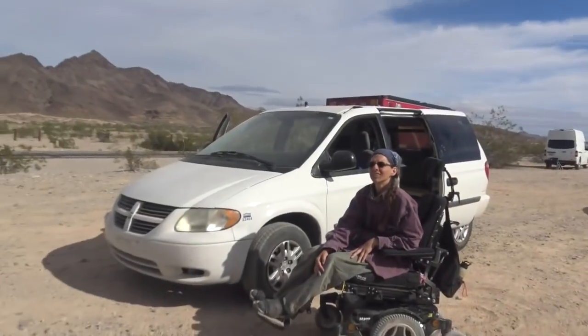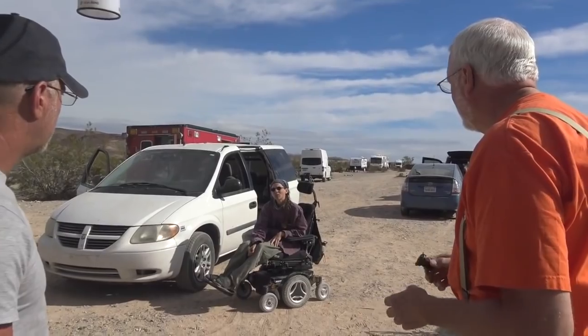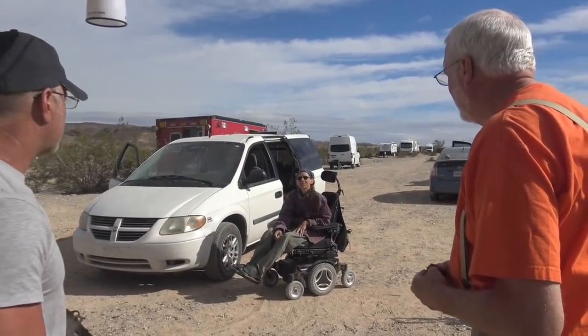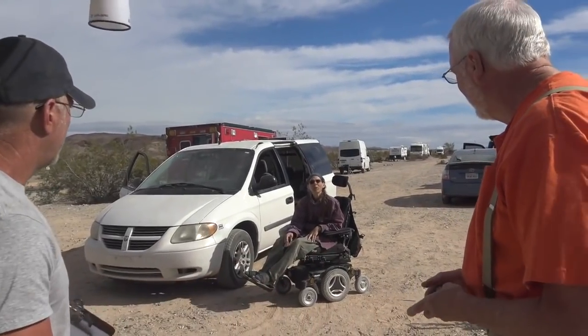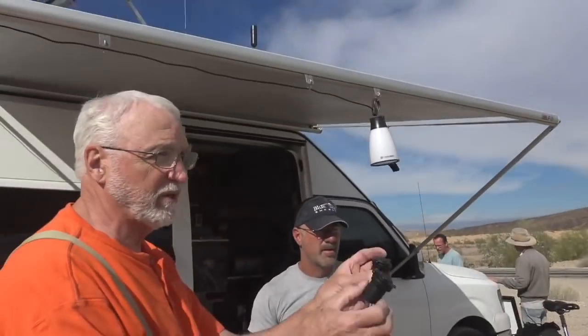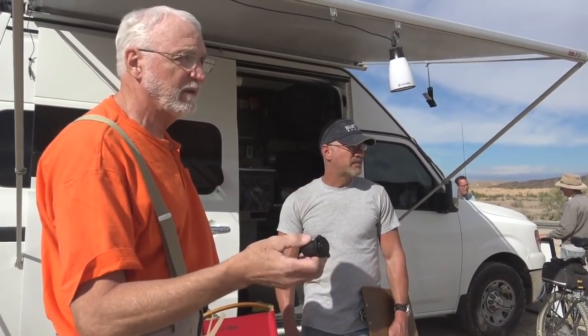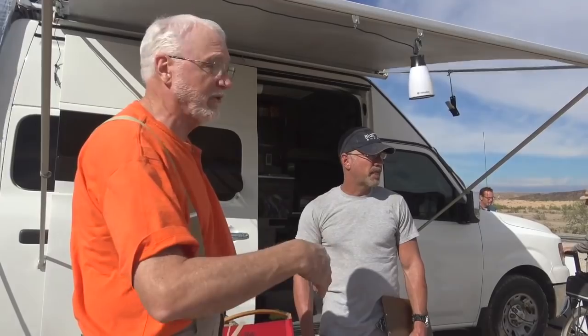Why are you mounting a water pump into this? Because it's a DC water pump. Well, we can just wire it into the battery or into the fuse block. Yeah, except we don't know when the water situation is going to happen. Plugging a full-time appliance into one of these DC sockets is not really what you want to do. The refrigerator is probably going to come with a cigarette plug — that's what you plug into this socket. A water pump, on the other hand, comes with bare wires, so it's better to just hardwire it to the fuse block. That's what the fuse block is for.